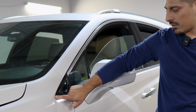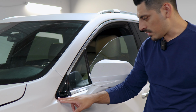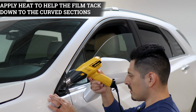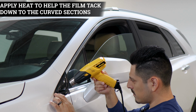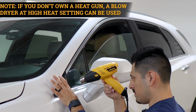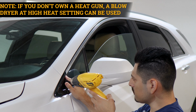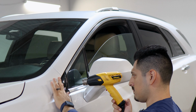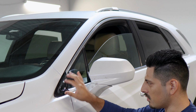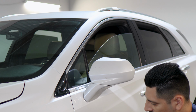And that's it. And now we're going to apply heat around the curve. That way we help it tack down and mold around the curve. So just grab your heat gun and apply heat around the panel to help it tack down and also around this curve here. Now, if you notice, the film has completely molded to the panel,